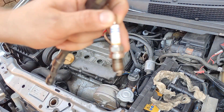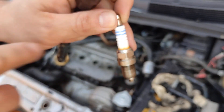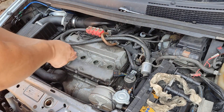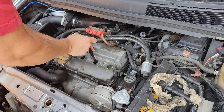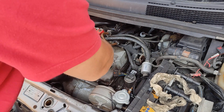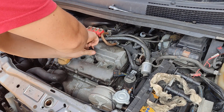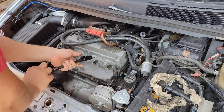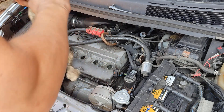If you see cracking or damage on the side of your spark plugs, it means it's gone — that's the easiest way to determine it. Otherwise there is a special tool you need to check them. It's so inexpensive to replace spark plugs that it's not even worth thinking about whether it's time to change them. This one is very white, so it's a bit lean.